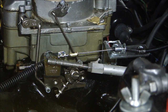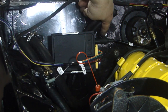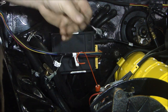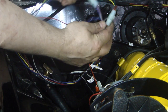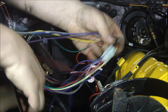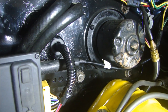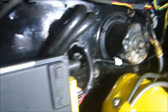Now let's go and put the wiring through the firewall. I'm simply going to run the wiring harness through the firewall here with a grommet. The connector here goes down to connect up to the hall switch on the drive shaft, along with a ground wire. The rest of the wiring harness has to go through the firewall. They make it pretty easy - they give you two connectors so it disconnects, making it easier to get this through the firewall. There's a relay and a couple of fuses in here. The unit is mounted, and I have the entire wiring harness going through the firewall there with a grommet, nice and neat. I'll run the wire for the pickup sensor on the drive shaft through the carpeting.